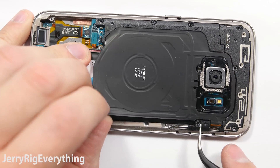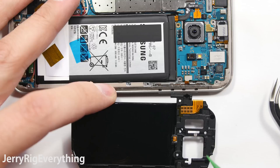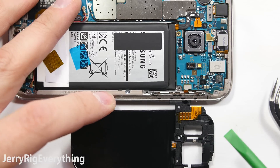Then the plastic loudspeaker can be removed from the bottom of the phone. Same thing with the QI charger, and then the plastic bit at the top. The nice thing about having a QI charger that doesn't go through the charging port is that if your charging port breaks, your QI charger will still be able to charge your phone through the contacts on the motherboard.